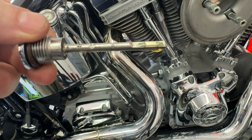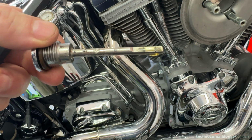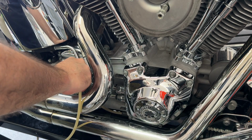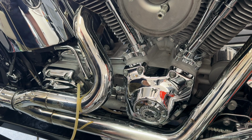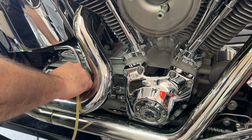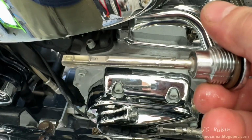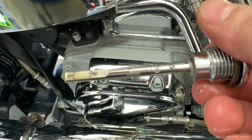When I removed it, it was clear that I overshot it. It should definitely not be over full. A reminder that it is easier to add fluid than it is to remove it. My vacuum system that I use for brake bleeding makes this somewhat of a painless process. After removing some fluid and remeasuring a couple times, we see that we nailed it right at the fill mark.